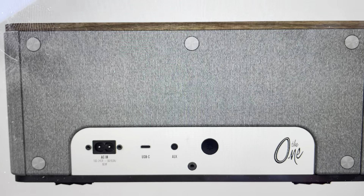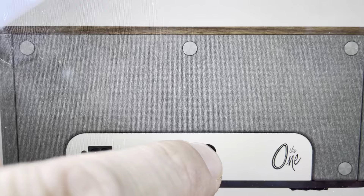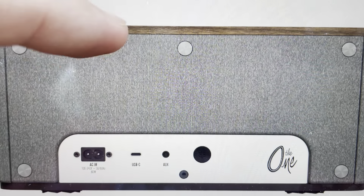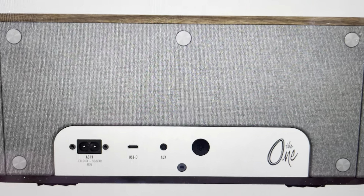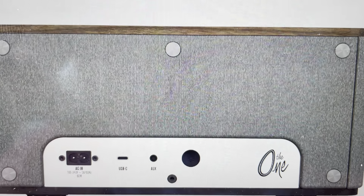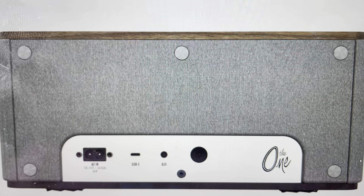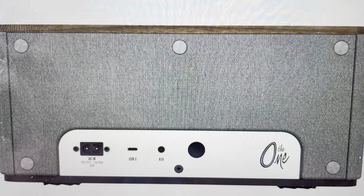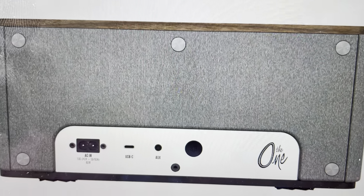It's really easy to do. With power to it, just come and press this reset button back here and press and hold it, keeping an eye on the lights on the top of the speaker. When all four lights light up in orange, go ahead and release the button. It will now be reset, and you can go ahead and connect this speaker and set it back up basically like it's a brand new speaker — you'll need to delete the old version off your phones and everything.